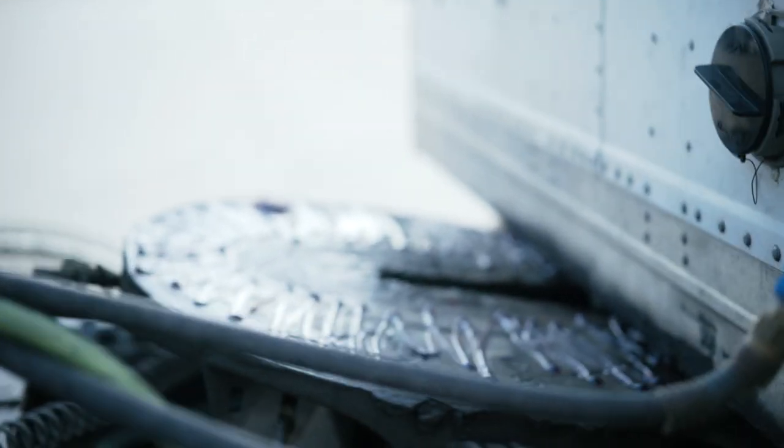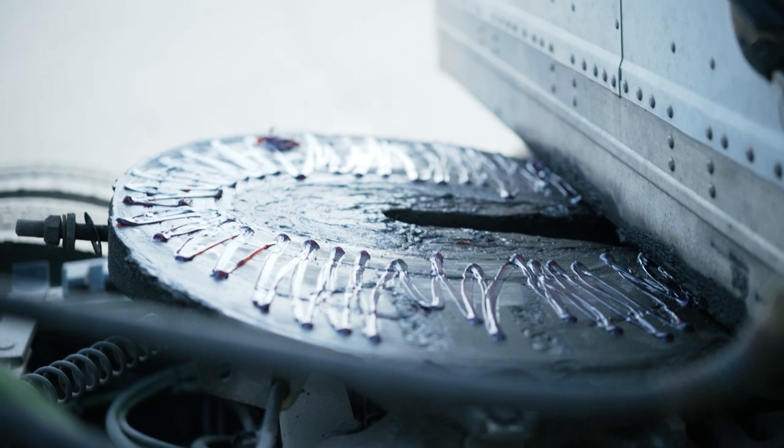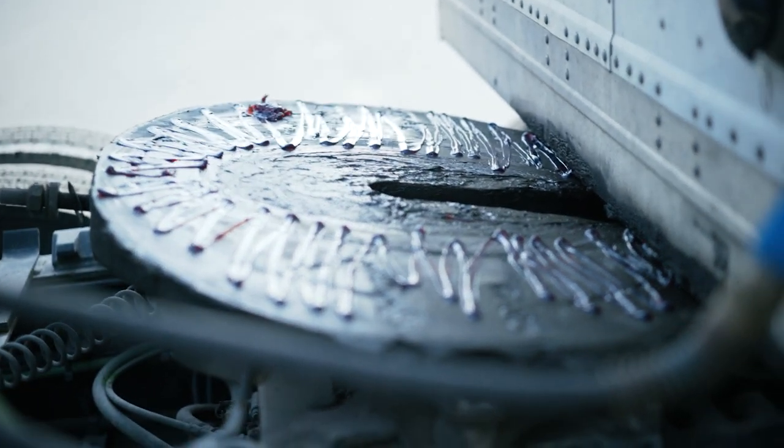To properly grease your fifth wheel, I do it from home — I'll take a grease gun and grease it back and forth the same way they've done it in the shop. You could also take a stick, as long as you get some grease on there. It's always good to put a little bit of grease in around where the locks are — that way it keeps them working correctly and properly as well.